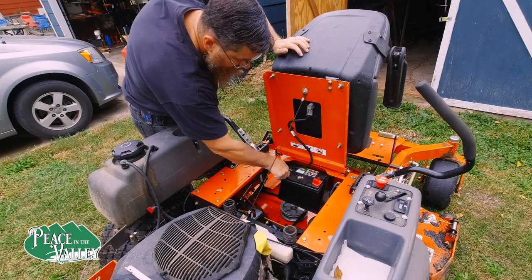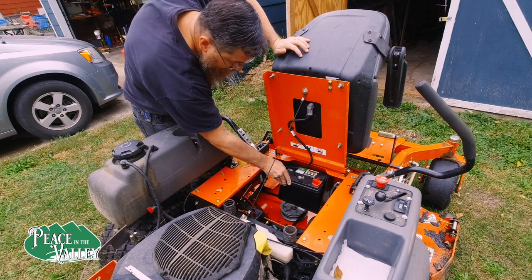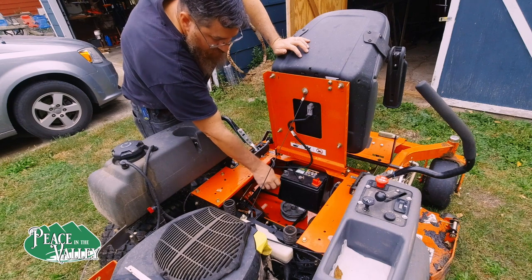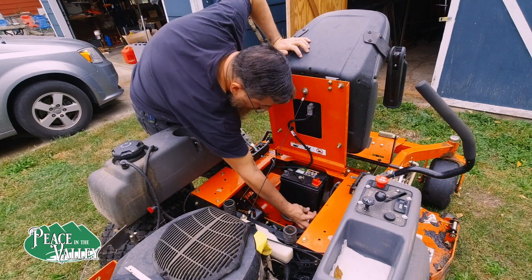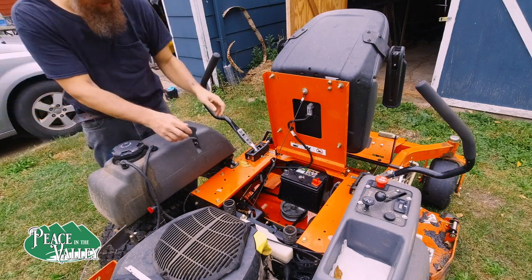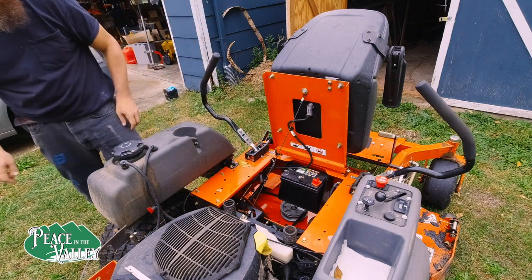So here it is, the new battery. I'm going to try to put a lip right here, weld on a piece of angle iron, hopefully from the bottom side, maybe two pieces, one here and one here. I don't want to do a whole thing, that way water can't necessarily collect in there, but just put a piece here and a piece here, and we'll clamp it on and see if we can do it. It's got to be small enough that we can lift the battery out with no problem, but tall enough that it won't vibrate over the top.